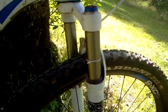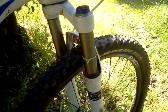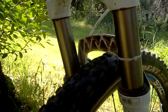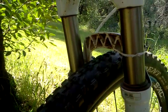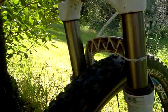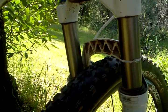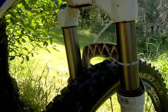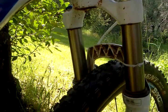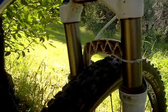So that's my take on air forks. Some people are afraid to adjust it because the bike shop did it and that's the way it's supposed to be. Well, I went on a demo ride set up by the manufacturer of these particular bikes, and man, they just had too much air in everything — too much air in the tires, too much air in the fork. I took a little out and the bike turned into a dream to handle instead of the rigid thing it was. And it was a 6-inch travel bike — I was getting more travel out of my 4-inch travel bike here.